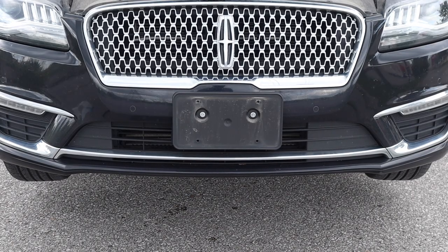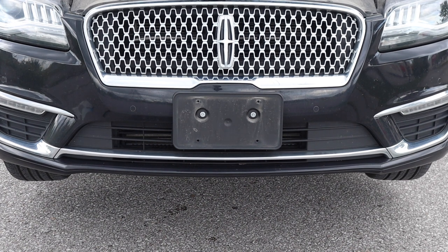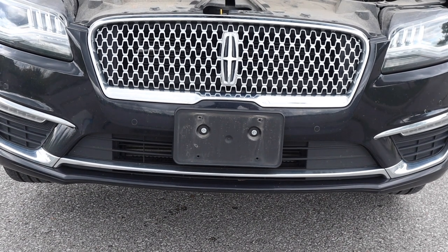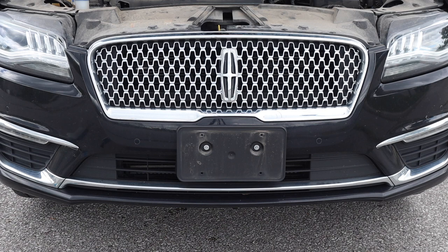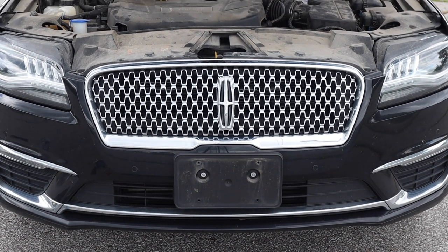Removing jack stands and lowering before rain. Remember, one side at a time, 3 inches, 3 inches, 3 inches, 3 inches. Turn the handle on one side, catch it, tighten it. Go back on the other side, turn it to the left, catch it, tighten it, until you slowly lower the car gently. The audio's in here, so you know there's no creaking, no damage, nothing. Those points are strong.